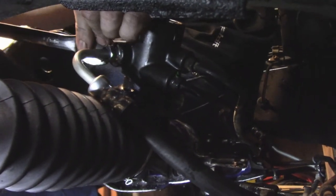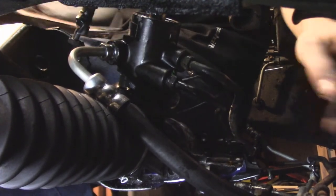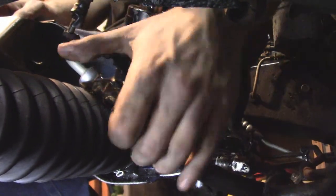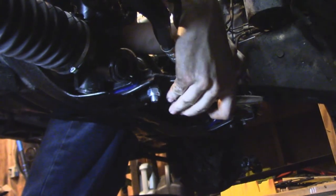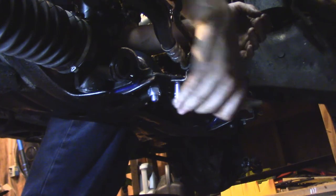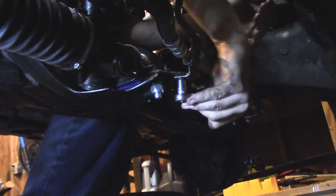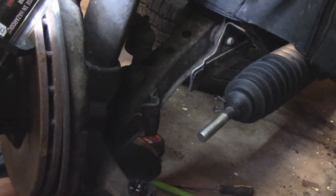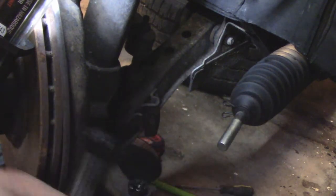Don't freak out. I realized that that line was going to interfere with the steering rack, but once we get everything tightened down — and there are these two clips with bolts that connect back to the subframe — it keeps the lines in nice order and straightens everything up. It's the kind of detail stuff that always fascinates me about the engineering that goes into cars. With those lines tightened down and the clips installed, everything lines up perfectly, and it looks like we should have one good, smooth operating, hopefully leak-free power steering system.